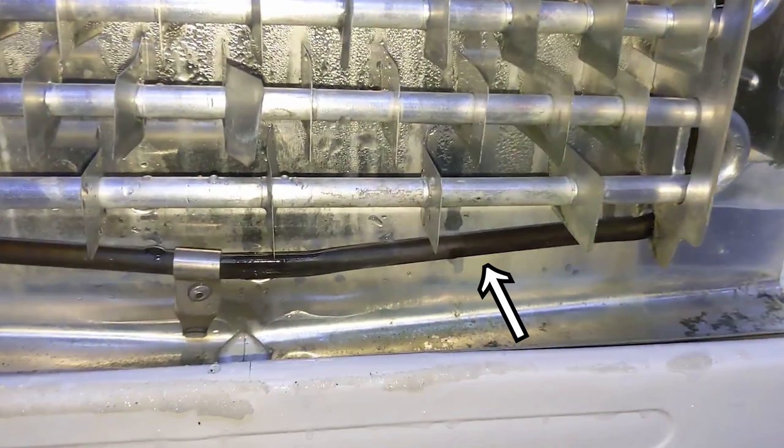We humans are clever though, so we started incorporating electric heaters that wrapped around the evaporator to do the defrosting for us. With the help of a timer, the refrigerator would periodically stop refrigerating and switch on that heater to melt any ice buildup. A drain pan would direct that melted water to a holding area of some sort where it could evaporate to surrounding air, sometimes with the aid of a second heater. After either a predetermined period of time or with the help of a defrost termination sensor, it would shut off those heaters and get back to refrigerating. And now defrosting was a thing of the past.